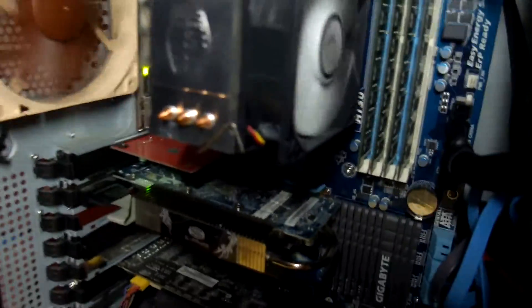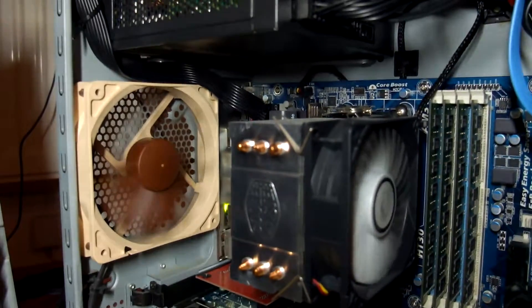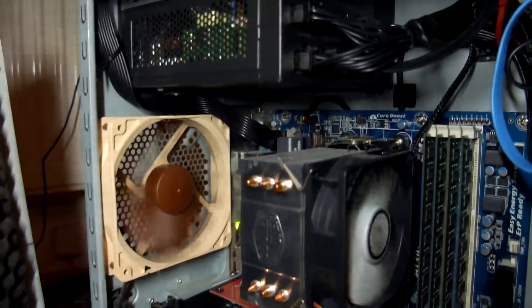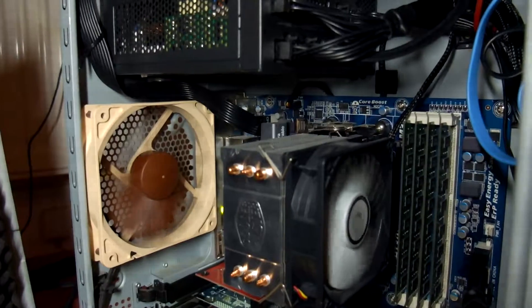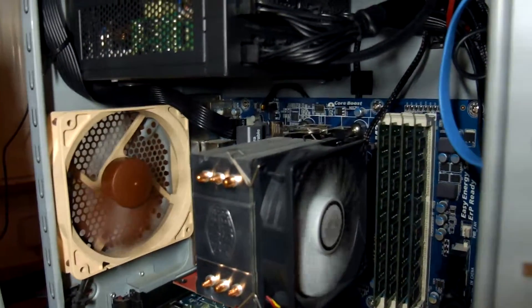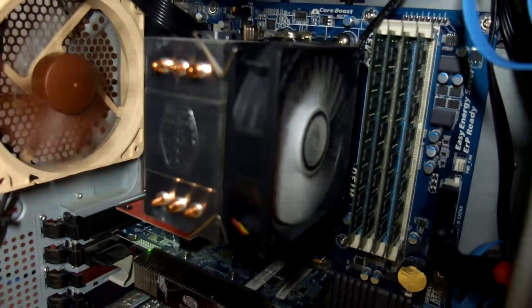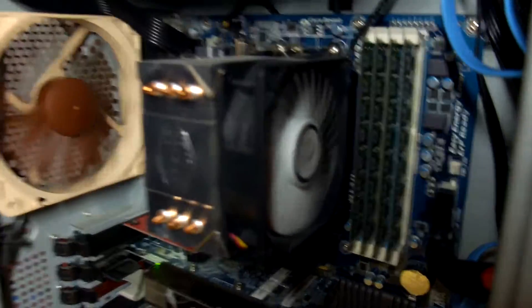If you're building a quiet computer, my main suggestion is to make sure you have a decent 120mm exhaust fan. I use either Noctua or Gelid fans — they're nice and quiet, and because they're larger they produce decent airflow. This case is pretty close to as quiet as you can get. There might be a small amount of noise from the hard drives, but with solid state drives there wouldn't be much point in a fanless PSU if you have noisy components inside.